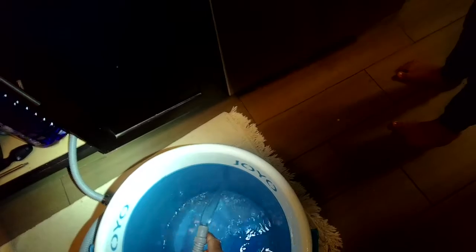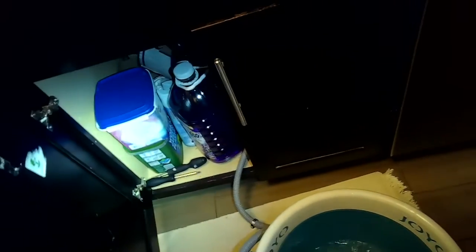So to get in the way of that, once you install this hose, you want to bend it in a high loop where it goes up basically as high as the countertop. And that'll keep water from flowing backwards into your dishwasher, and also will allow you to have really good drainage from your dishwasher. And you probably never will have to have a technician come out and fix your drain.